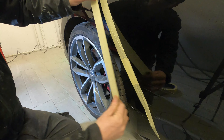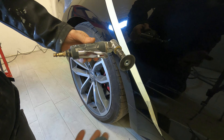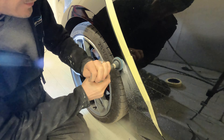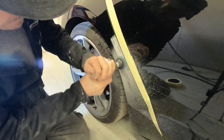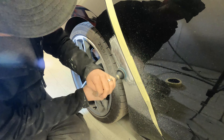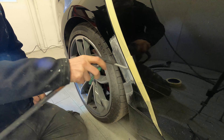All the way through this video, any of the tools and products we use I will leave a link in the description from our sponsors at PMP Supplies, so if anyone's interested in the dent puller system or anything else, you can find the links below. We're starting off by using a die grinder with these little three-inch flat wheel discs to clean up the metalwork on this wheel arch, so we can get a really nice solid weld with the dent puller. It's essential to have a nice clean area — and it also gives us a good surface for the magnetic earth and the filler work.